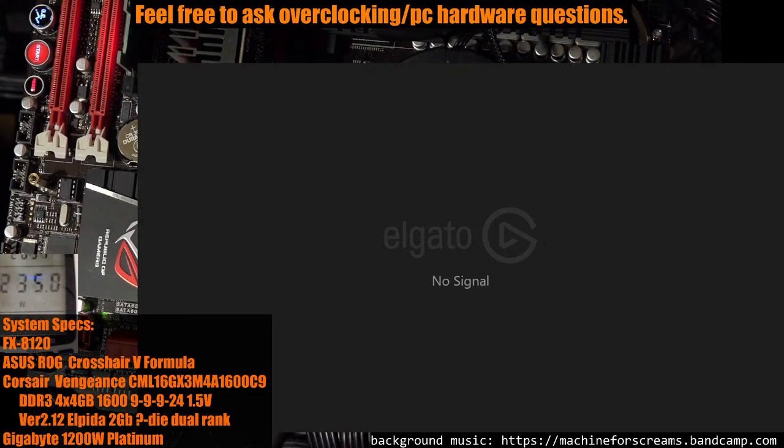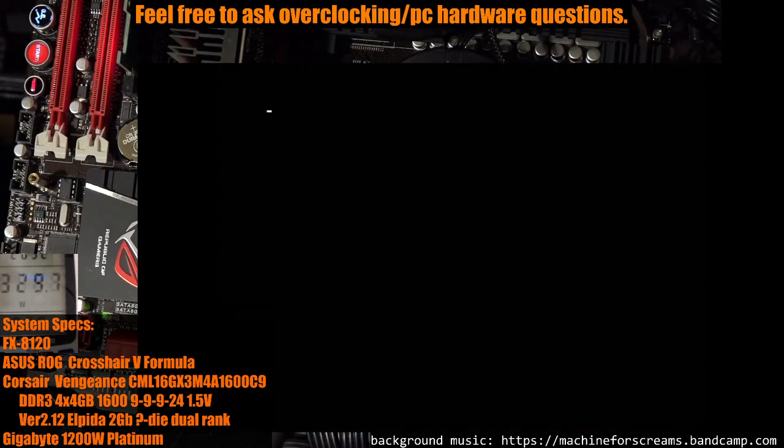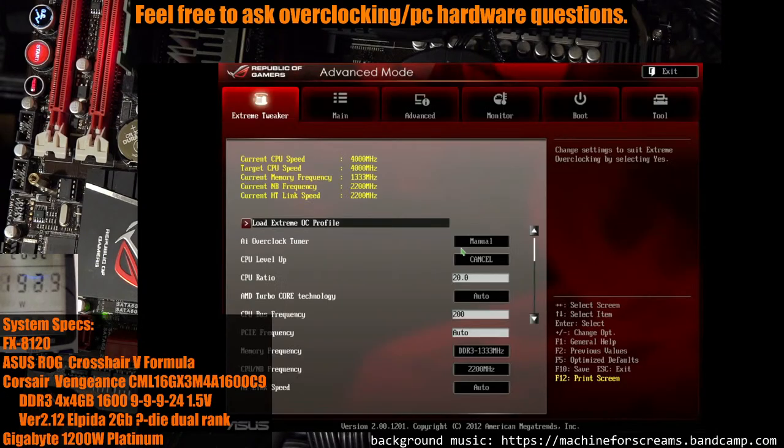Right? Oh, no, it was 5.6. Yeah, so this thing is a potato. I don't know, maybe there's a chance that on liquid nitrogen it gets massively better, but I really doubt it, because it won't even run Cinebench at 5 gigahertz, whereas it does Cinebench at just 4.9 on water cooling. If I had to guess, for validation, I'm going to guess this is a 7.5 CPU on liquid nitrogen, which is not good.